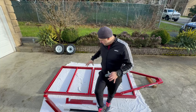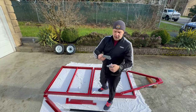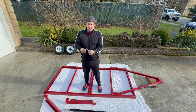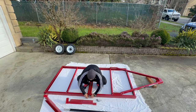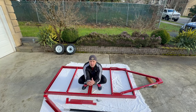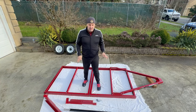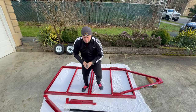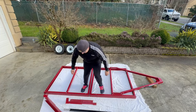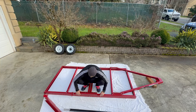If you want to build that trailer foldable, you have to mount that hinge. It's coming like that. Here. You see? And it's coming like that. Okay? But me, I'm gonna build that trailer unfoldable. So I'm not gonna put that hinge. And I'm gonna put that solid spring hanger here.